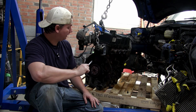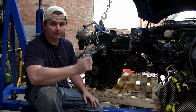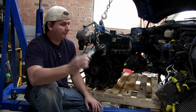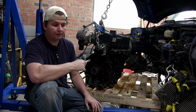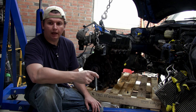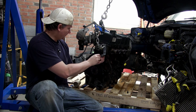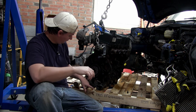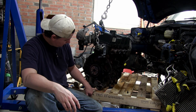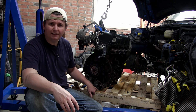New day. I've taken a lot of stuff off the engine already, but before I do anything else I want to put it up on the stand — the stand I just built. I looked online for what bolts you needed to mount the engine stand to the actual engine. M10s is what I found, I went and bought some. Those are not correct — M12 is what you need. There are four slots here, and one hole is full of metal filings.